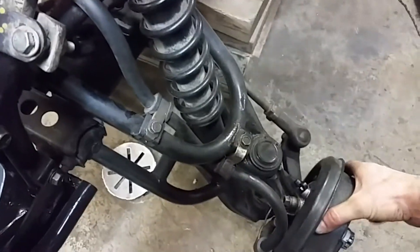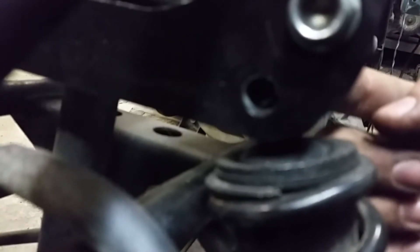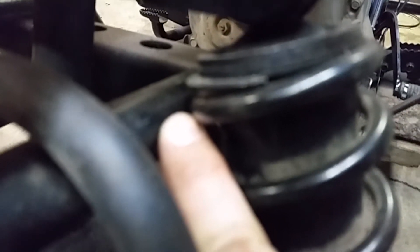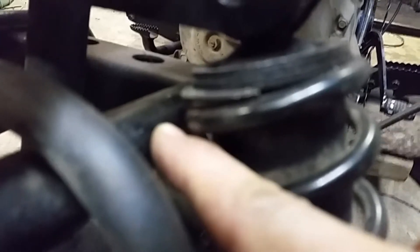So what I did, I just lifted them up a little bit and marked the position here, then made the hole. The key is to just lift it up a little bit to avoid the maximum ball joint position. And in the back here, just leave a little space to be sure it's not going to hit the frame.